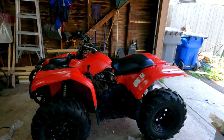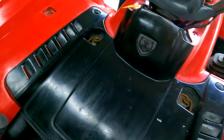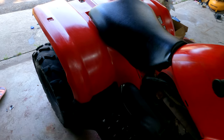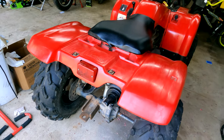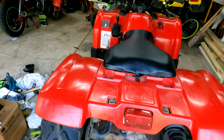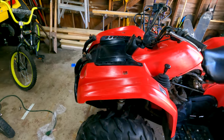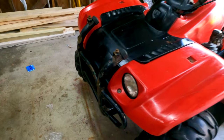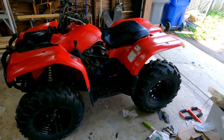I got all the plastics done and I think it turned out pretty good. I even got that black part right there. What worked best for me was the heat gun after I got all that white stuff off. All plastics are different, so if you're thinking about doing this on yours — Honda, Kawasaki, Suzuki — just do a test spot to see which method works best. I'm going to finish restoring this, do the racks and the black metal, paint it up and get this thing looking real nice. Thanks for watching, and hopefully it works for you.